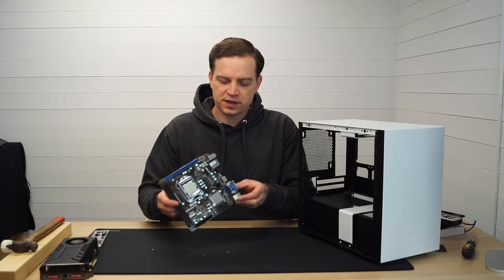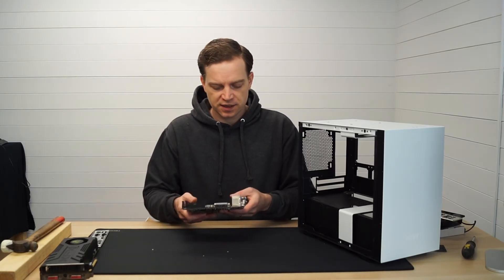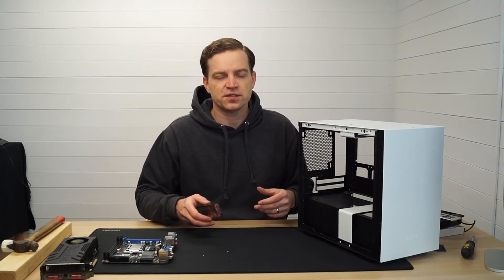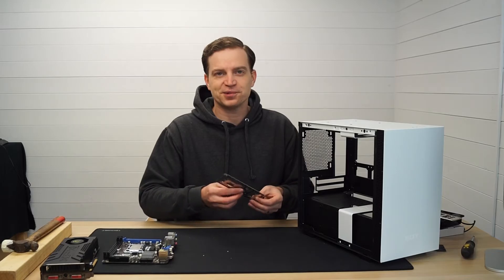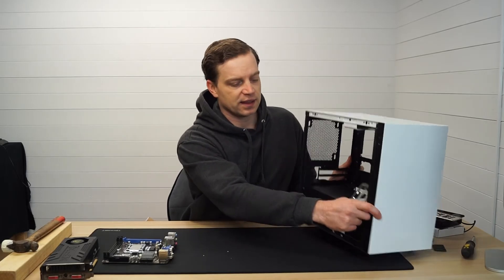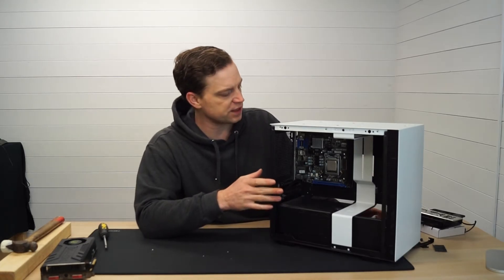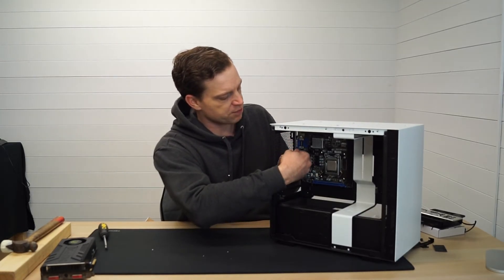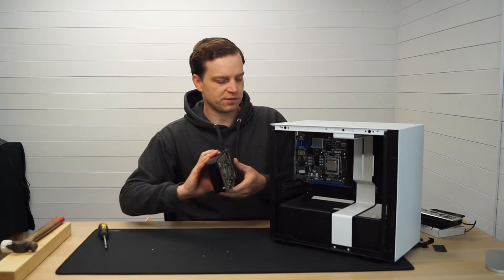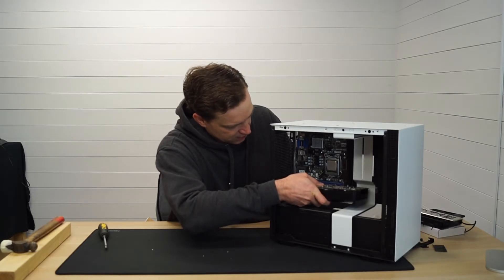I've managed to pick up one of the motherboards I've got in the inventory - it's an older MSI ITX motherboard from a second and third gen Intel. It's not a bad board but it's going to be enough for us to test this. Obviously you don't want to be testing the fitting on a repaired case with your brand new ITX motherboards because they're not cheap. Now that we've got the motherboard installed, we can actually see that everything is aligning up perfectly well. The IO shield itself is pretty much keeping everything in square and in place, so what we need to do now is drop a quick graphics card in to make sure those PCIe slots are lined up as well.